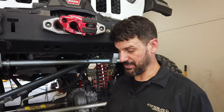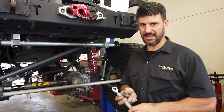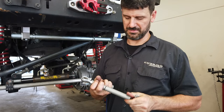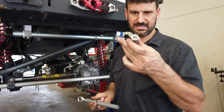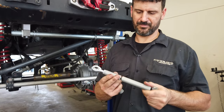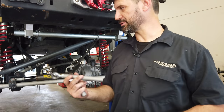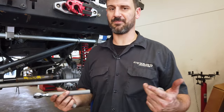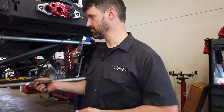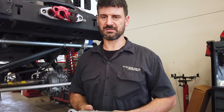One of the other many cool features about this kit is the adjustability of the sway bar links themselves. These actually come in several different pieces in the kit to make the links whatever length you need them to be. There are a few pieces of all-thread in the kit, threaded on both ends. You put the all-thread in there, screw the links in to whatever length you need, put the heims in them and bolt it up. Instead of having to have a bunch of different length sway bar links, you just put together what you need and toss the other ones aside.